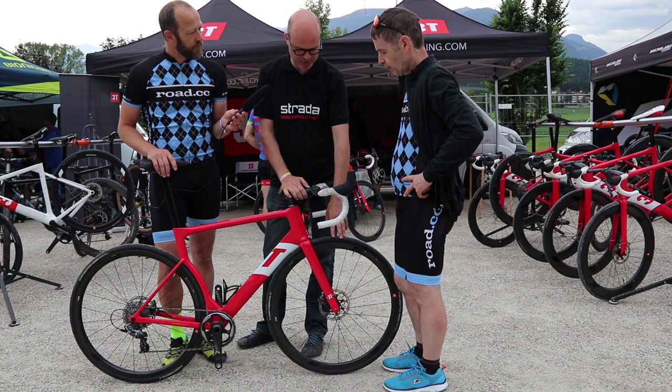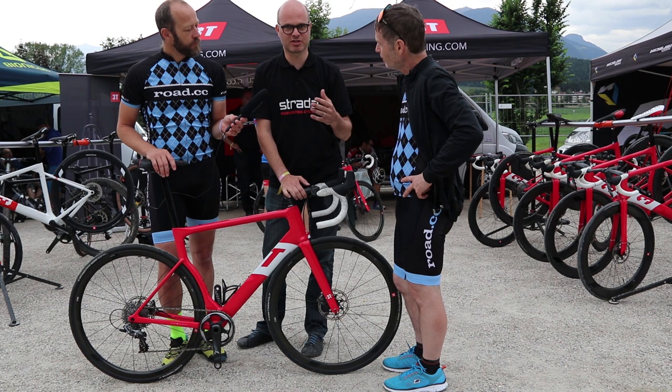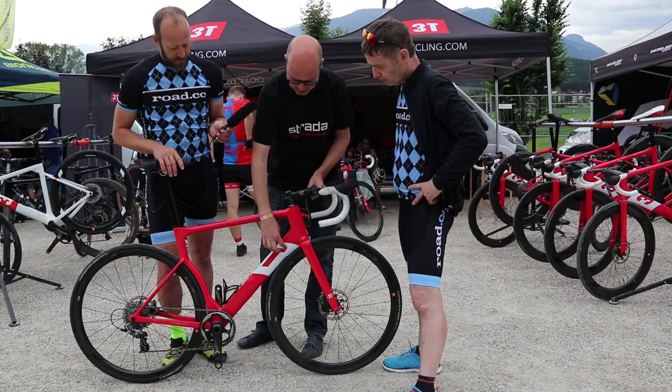So it's designed around 28–29 millimeter tires, like this Continental 4000. Often the idea is that bigger tires aren't aerodynamic — but that's not really fair if you put them in a wheel or frame that's designed for a 23 millimeter tire. We did it the other way around. We started with the tire and designed everything for aerodynamics back from that. All the tube shapes and gaps with the frame are optimized for this bigger tire.